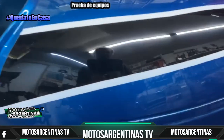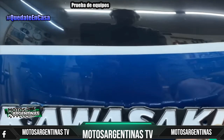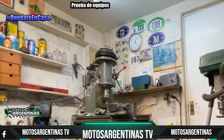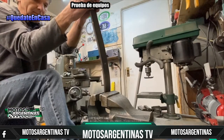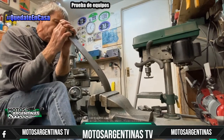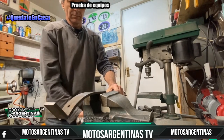The next job is to fit the badges to the side of the tank. Now these pattern badges, they come straight and you have to bend them into a curve. Some of them are brittle, some of them are soft, and they're very hard to bend by hand without potentially snapping them. So the easiest way to do it is to get a bit of steel bar, bend it in the vise into a radius that sort of matches the tank, just by eye, it's good enough. When you're happy with that, you put that back in the vise and do it up really tight and use that as a former to bend the badges.